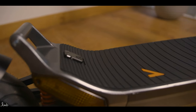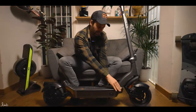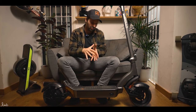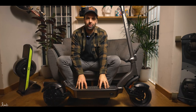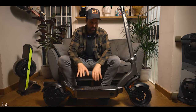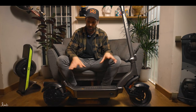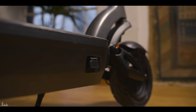Moving to the deck: it's fairly thick with a big battery inside. The shape comes out at the shoulders and tapers right back — not thin and not too wide, just a really aesthetically pleasing aerodynamic shape. There's rubber anti-slip matting on top. Housed within the deck is a 15Ah 48V battery using 21700 cells, which are higher capacity than the 18650s previously used. Apollo say this gives up to 25 miles of range, though I think they may have been a bit conservative with that estimate.